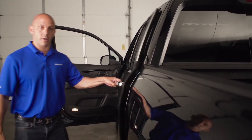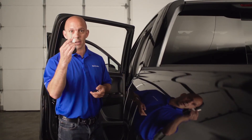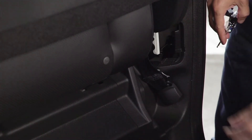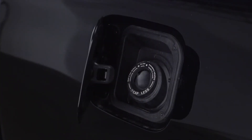You open up the rear door. Separate the key from the key fob — you're going to use this part as a tool. You're going to open up this plastic container. Once you open up this door, inside is going to be a white trigger. When you pull that trigger, it opens the gas door right up.